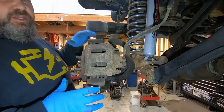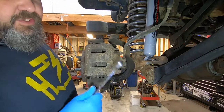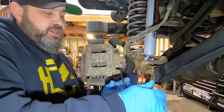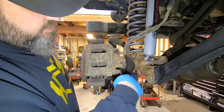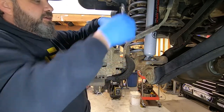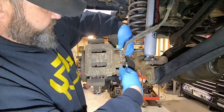I've been trying a little bit better with shot framing. To get these calipers off, there is a bolt here and a bolt up here, so we'll go ahead and take these out. Be kind of careful because a lot of times these will get rusted in place — you do have an opportunity to break them, just like every other rusty vehicle up here in the northeast. Take those out and you'll be able to pop your caliper off.